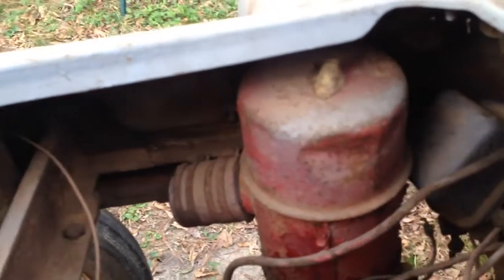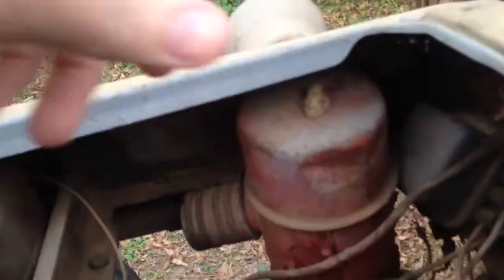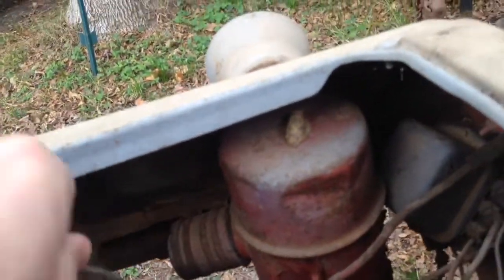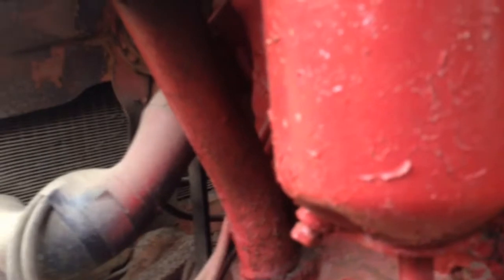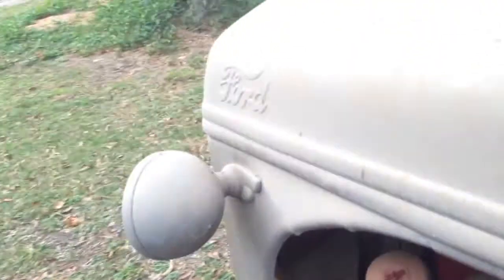What we are going to mess with - we're going to rerun a new wire to the coil. And we're going to get rid of this headlight wiring because this is a mess. I know at least that one over there, the wire going into the headlight, the insulation is off of it and it's grounding up against the housing. That's just a direct short. This one over here is not much better.